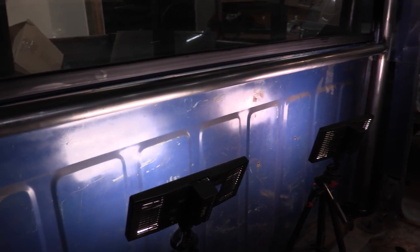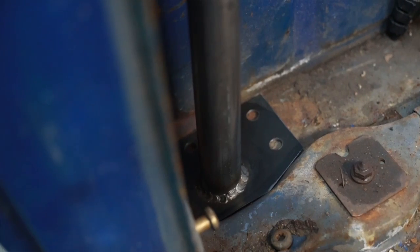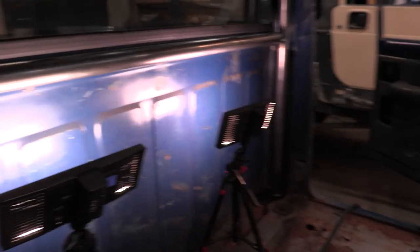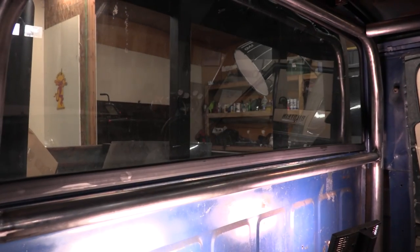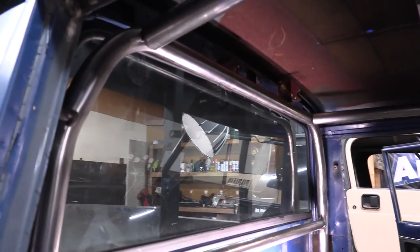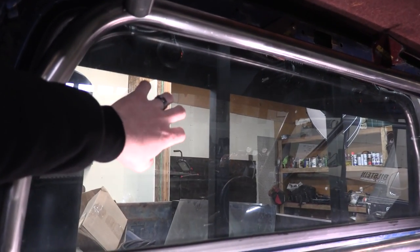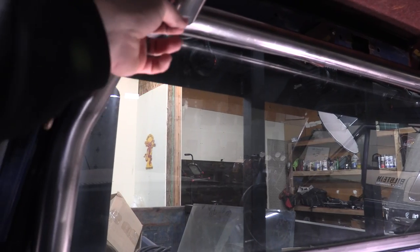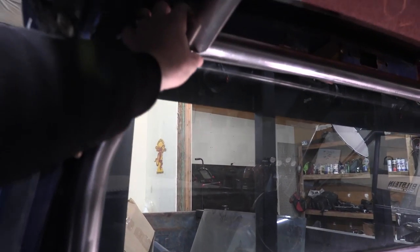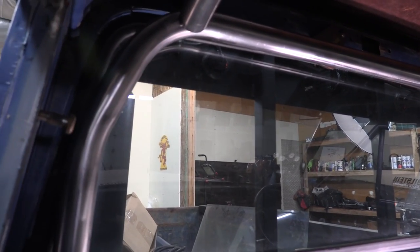Before starting this video, I wanted to take care of the low-hanging fruit. I welded in the seat belt bar because I knew it was going to be difficult to get the welder behind there. I welded in these bottom plates here, and this back hoop is pretty much ready to go. I just located it, and the next thing I want to work on is coping the edge of these tubes right here. I'm going to protect this back window with a welding blanket, cope the edges, then take a hammer and bang in the bottom and the top to make sure everything is nice and tight so it makes it easy to finish weld.